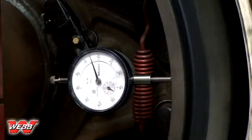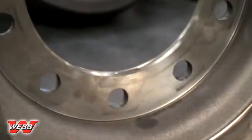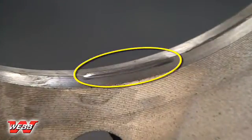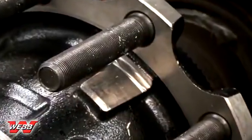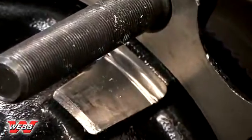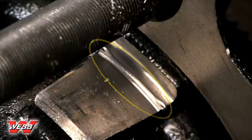This will lead to uneven wear and vibrations or an out-of-round feel. Inspection of this brake drum's pilot reveals an indentation indicating a mismount. Further inspection of the hub's drum pilot reveals deformation as if the metal has been shaved. This damage will prevent future drums from centering properly, so any hub with this type of damage must be replaced.